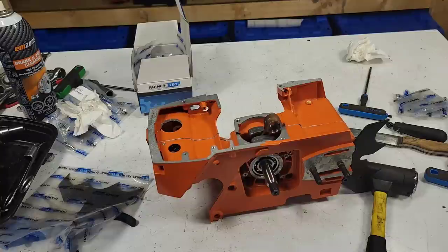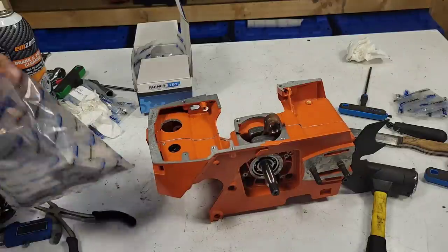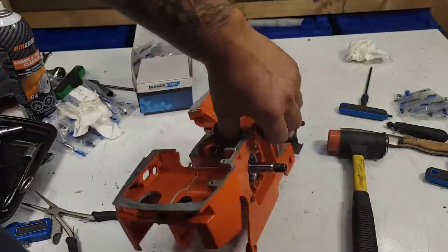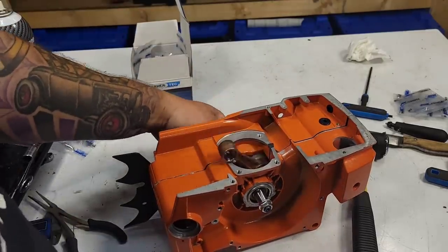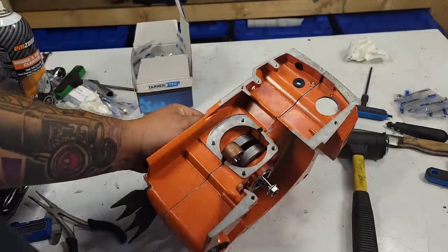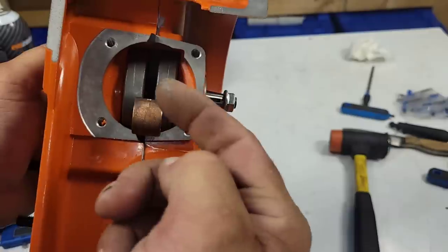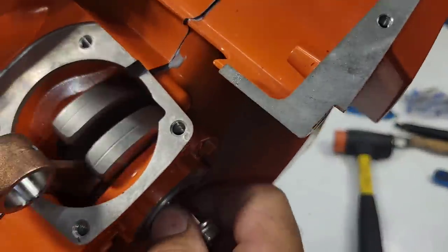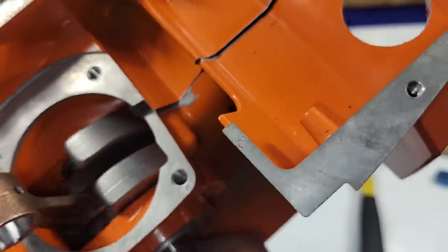That's just me. You guys don't have to do that, but if you're a novice and you're not sure, I would pop that crank seal out so that you can feel what a bottom end should feel like, okay? And again, whack it one way and then the other way, and you'll get it centered, and now this thing's smooth as butter, okay? With no oil in it, too.